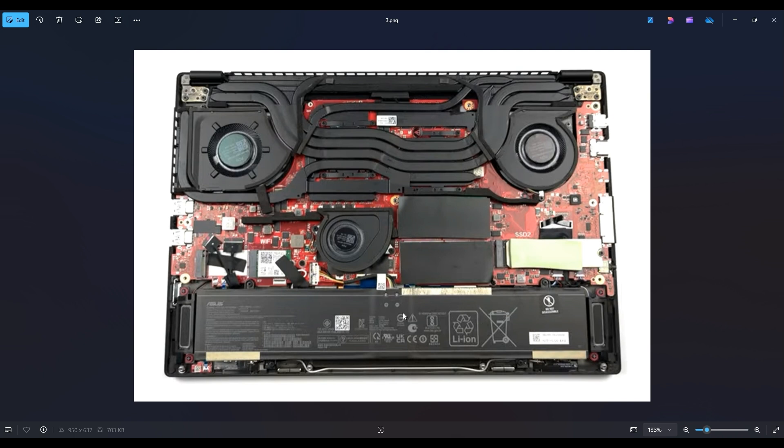Your battery is right down here near the bottom of my screen. The part number for this battery was C41N2109 — this is a 90 watt hour battery at 15.52 volts. I'll list all that information below in the description if you're trying to find your own replacement. To get this battery out, you have four screws: two on the bottom and two on the top. Then to unplug it from the motherboard, the cable comes up right here and plugs into the motherboard right here. This white plug is a snap — it snaps onto that port, so you pull straight up and off of the motherboard.